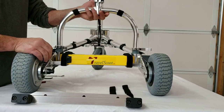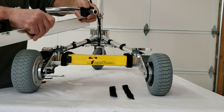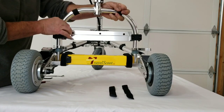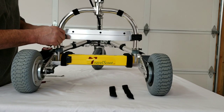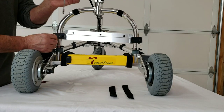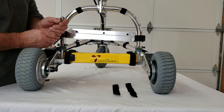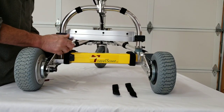Next up, very simply, remove your yoke. Slide the auxiliary battery tray over your seat yoke like this. Get it up to about the level you want and reinsert it. Take your largest 5mm Allen wrench and insert it into the Allen head screws on the back side. You will need a 10mm box-end, open-end, or combination wrench — a pair of pliers works in a pinch. Just hold on to the bolt there and begin to tighten.